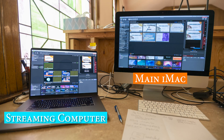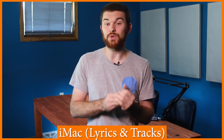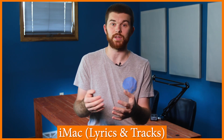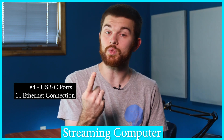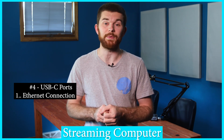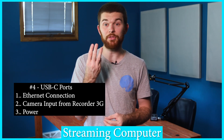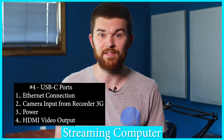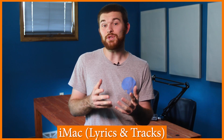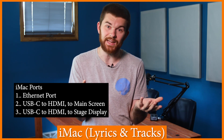So let's take a look at the two computers running ProPresenter 7 in front of house, what they are doing and where they're at. Our main iMac is doing all the lyrics and is also running tracks from Ableton Live. Song slides in Pro7 are set up to trigger automatically, which is really nice because we're using ProPresenter and Ableton to run our tracks. We then have a second computer, a MacBook Pro, that is handling the streaming. This computer has four USB-C ports: the first is a hardware ethernet connection for good upload and download speed; port two is the camera input from the 3G recorder via USB-C; port three is for power; and port four is an HDMI video output for the TV in our lobby. The TV in our lobby gets a separate output generated by ProPresenter 7 on this computer, independent from the live stream feed. Connected to the main iMac, we simply have a hardware ethernet connection and two USB-C ports connected to the screens — one for the main screen and one for the stage display.